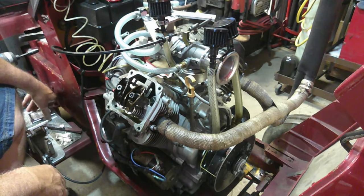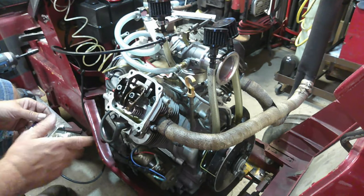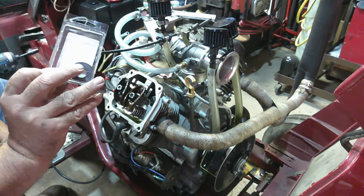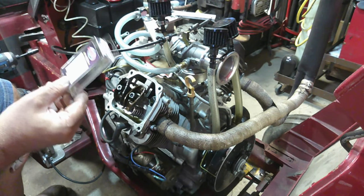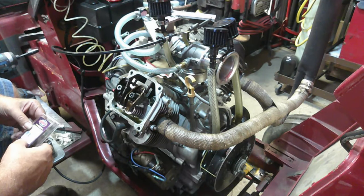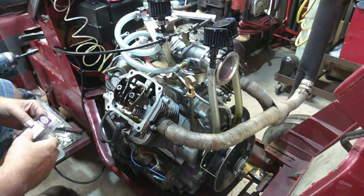I like to have them, at this point, 20 to 30 thousandths. I'm lucky to have a Summit Racing within about an hour from me. We picked up some valve spring shims — they just look like washers, but these are 15 thousandths. I wanted thicker ones. I'll probably put 30 thousandths in it, and that'll give me 25 thousandths clearance.